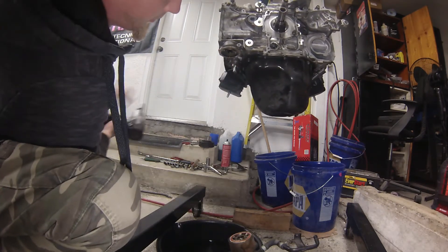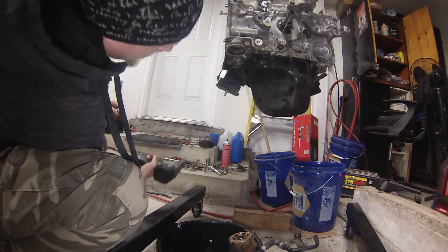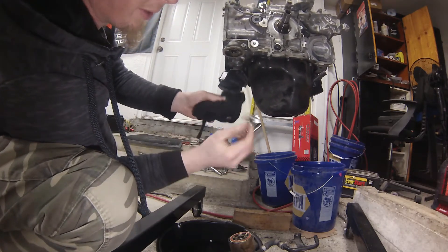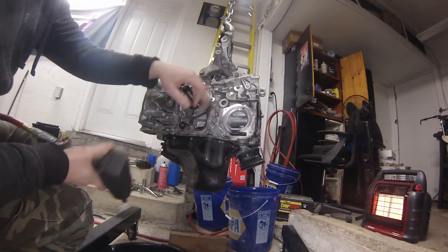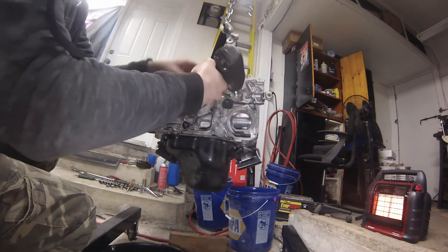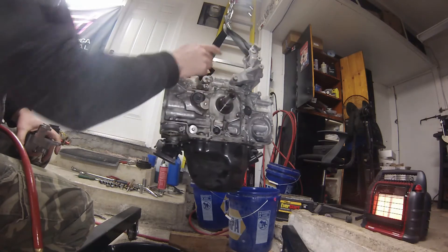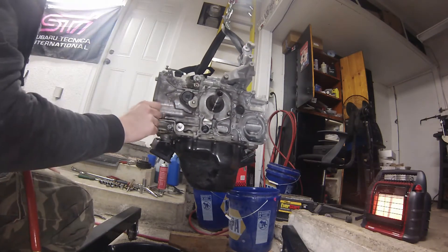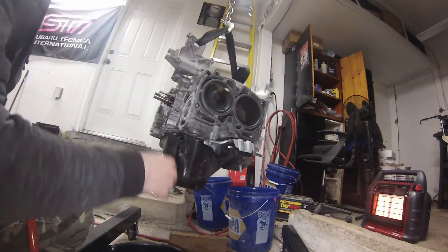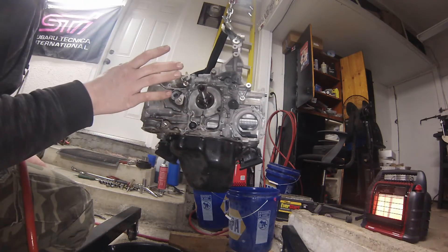This fitting for the water hose is also a 24mm. No gasket but certainly a lot of Loctite on it. The last thing I really need off this block is this tensioner support bracket. And I believe other than the AC bracket and the bracket in the back, that's it. The flywheel's got to come off, but I have a new separator plate and a new piston wrist pin cover.